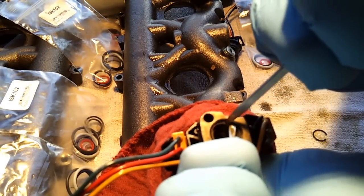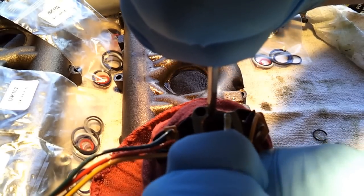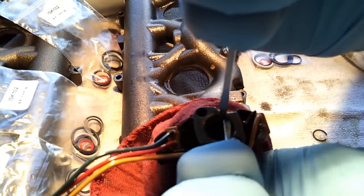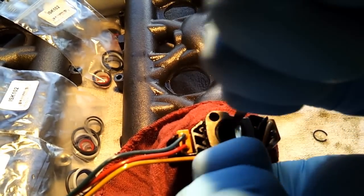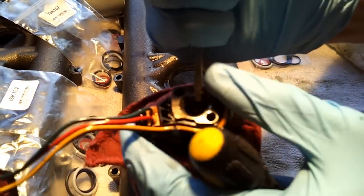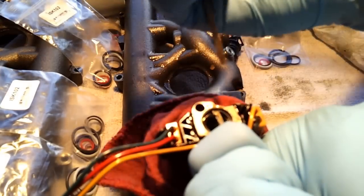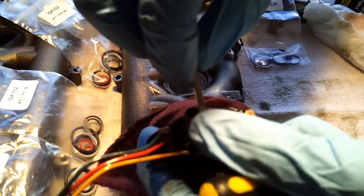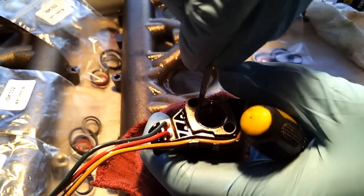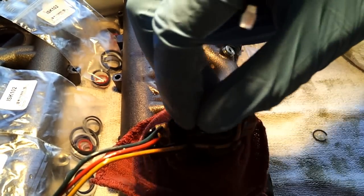until it goes down to the little recess and it'll stick there. Slide it around so that more of the clip goes down into the body. Hold that end down and then come back with your screwdriver and catch the end and pry it out and in. But with these Tech clips, it's really easy. You just grab the end in between your screwdriver there, and once you've got the end, it's just a simple matter of sliding it around. So your clip comes out.